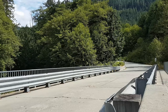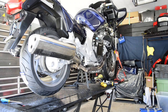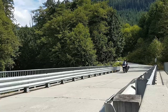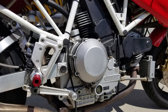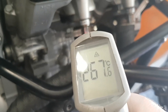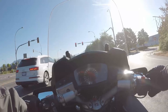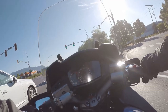The ST has a wide open space around the bottom of the engine to let air in, but really not a whole lot of venting to let air out. Air buffets against the engine and doesn't circulate fresh air to the top of the engine the way you would on most other motorcycles, because the engine itself is this big flying V brick with no air traveling over the top or directly behind it — the fairing design and the primary fuel tank located under the seat being the root cause. Most other motorcycles have an open area just ahead of the swingarm where air can circulate around the back of the engine. We don't have that on the ST. By lowering heat emissions off the headers, we can reduce fatigue on electrical components and sensors near the exhaust system and keep our secondary fuel tank and airbox cooler while sitting in traffic. As a byproduct, not as much heat is directed back towards the rider.